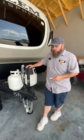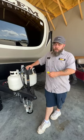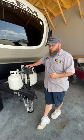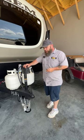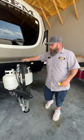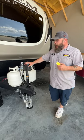I do always like to recommend, while you're still hooked to the tow vehicle, to make sure you're leveled from side to side. Usually you want to put a level right inside the doorway, or they have a little stick-on level so you can stick on the front and on the side of your coach. If you had to elevate one side, put a block down and use that tow vehicle to roll the camper onto that block. Once you're good from side to side, you can unhitch, pull the vehicle away, and then level front to back with this guy here.